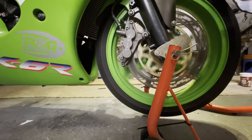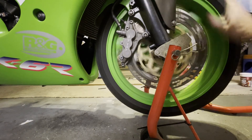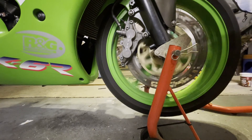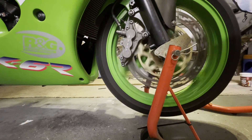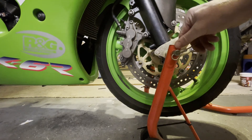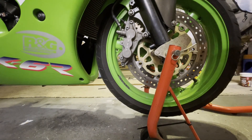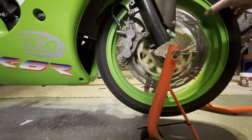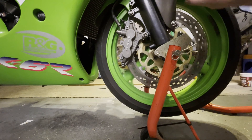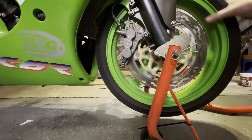Alright, well that's it for this video. One thing I've noticed though is that this front disc might be slightly warped, or one of them - I can just hear it catching when I spin it a tiny little bit. Probably not a major issue, I can't feel anything pulsing on the brakes, but it might be something for a future video anyway - to replace the discs. I'd have to get the front wheel off. I don't think I can do that with this stand because that fouls the axle there. I don't know if I can turn it round and jack it again - I'll try it anyway, but I might have to get another stand. One good thing is if I do get the wheel off I can probably refurb that as well, give it a good sanding down and repainting because it really is in bad condition. But yeah, okay - well thanks for watching. Hopefully it's been useful to anyone else who's had problems with their calipers after rebuilding them. See you on the next video.